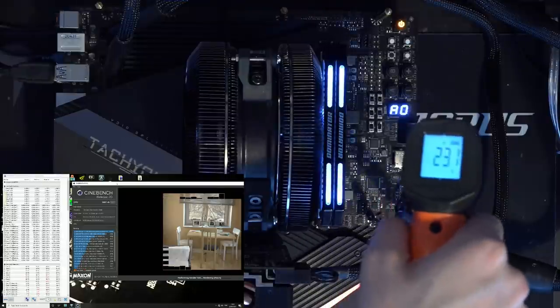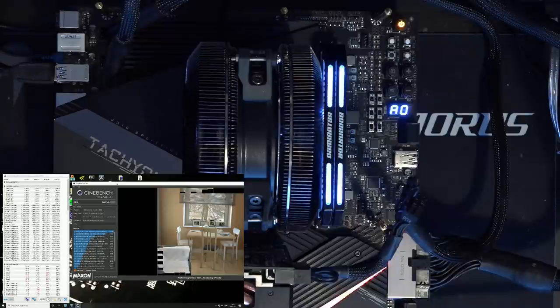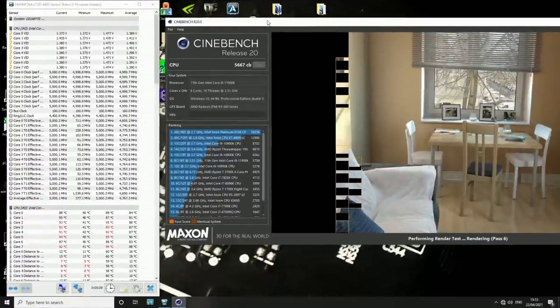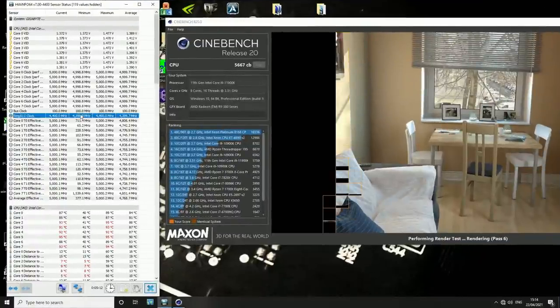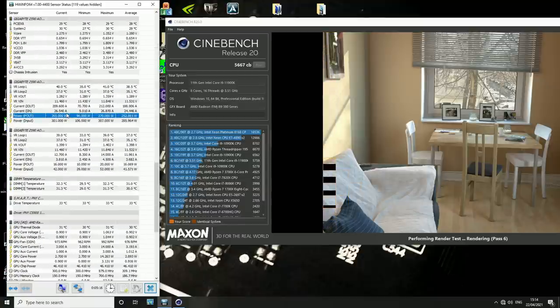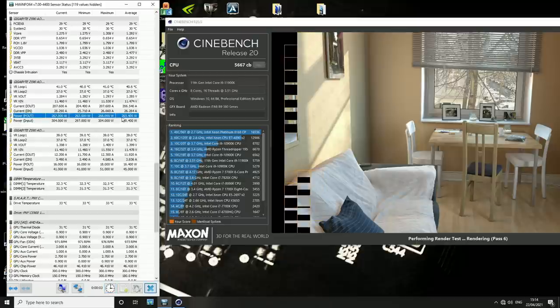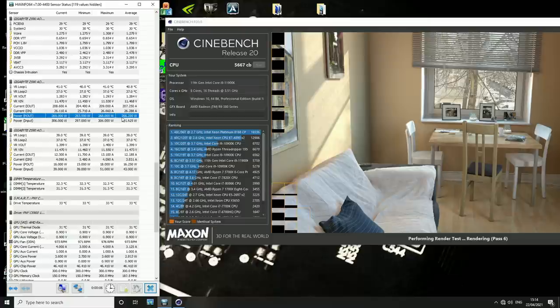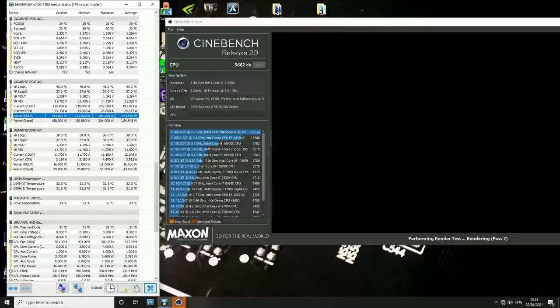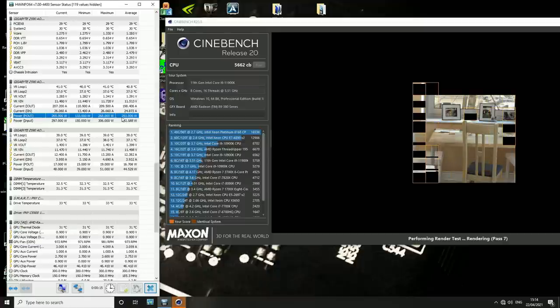The room temperature right now — I'm just going to point this at the desk — the room's at like 23 degrees Celsius, so that's not too bad, especially considering I'm running it at 5 gigahertz and not at minimized voltages or anything. So the CPU core voltage and the power draw is actually quite high — we're looking at like 260-plus watts at like 1.28 volts.